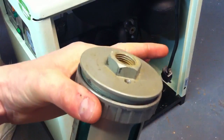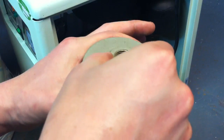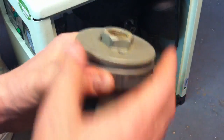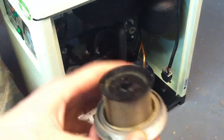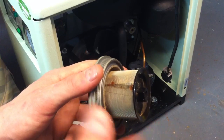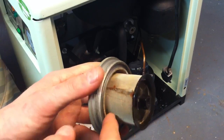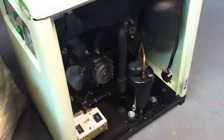This comes off — if you hold this ring, you turn it just like you'd expect, lefty-loosey, in case anyone's questioning. Sometimes with foreign-made things you'll see odd left-handed threads. Anyway, sure enough, when I took this thing apart, the inside of this piece was a mess. There were huge amounts of chalk-like or drywall-like debris inside this filter, so I can see why it was not working.